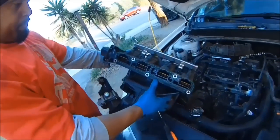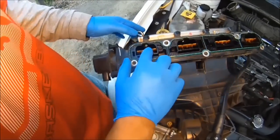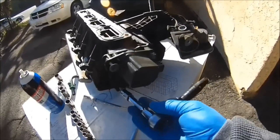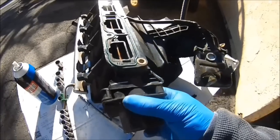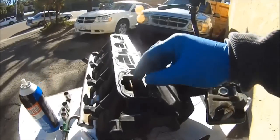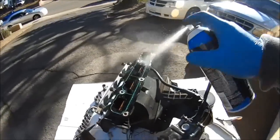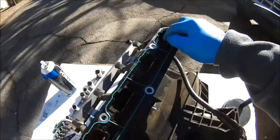These are the runners that are stuck. They're stuck open — this is P2004, intake manifold runners, bank one, stuck open. Look at that — they are stuck big time. They don't have any movement. We're going to pull this off and see if we can unstick it. On the intake manifold runner position sensor, you got three bolts here. Taking these off, I'm going to pop this out. Note the position of the runner flaps — line up right there. Slowly work that out. Now I'm going to check the flow. These seem to be good — I sprayed these last night with carburetor spray, let it sit overnight, and these runners are not broken at all.